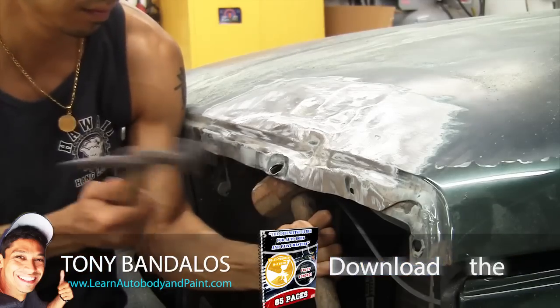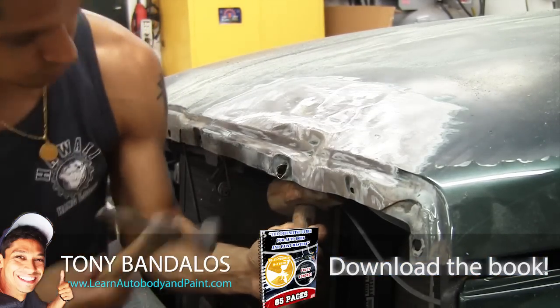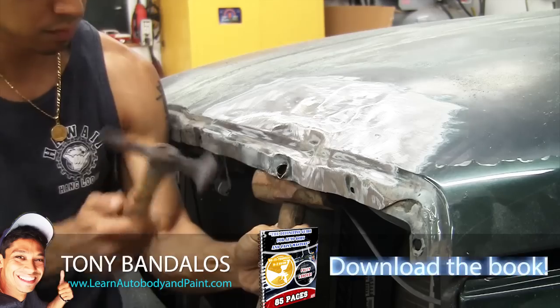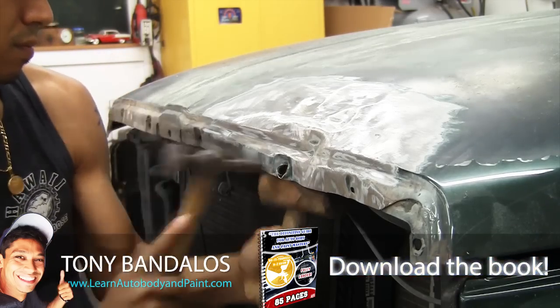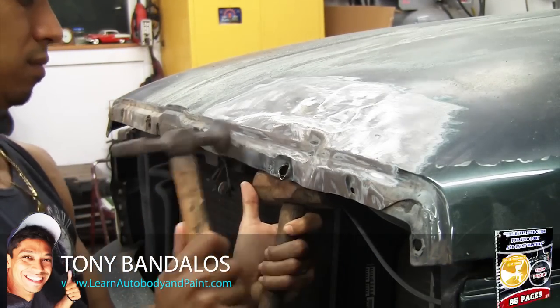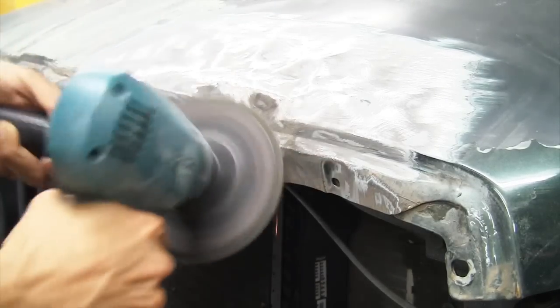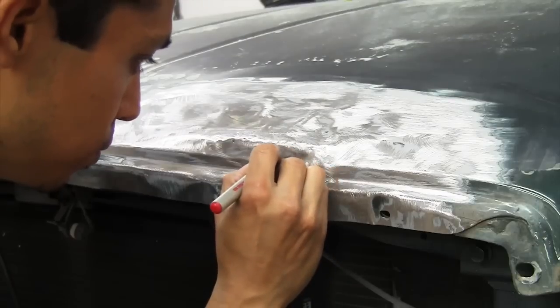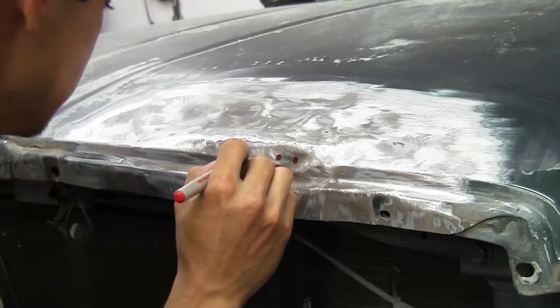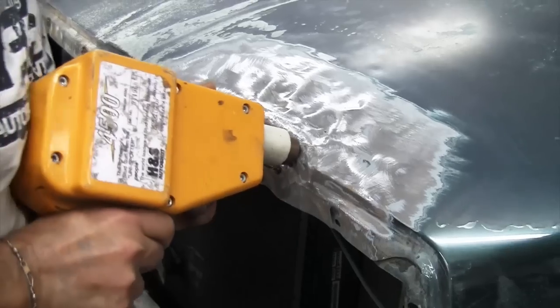All right, I'm putting a hammer in the back of the section here to flatten it out, right? Because the come along did a little bit of damage to that hole there, pulling it out. All we're doing is just bending it back together. Now we're gonna grind out the little paint areas in the back there, and we're gonna weld a couple more pins, pull those areas out, and hit the high spots down as well.